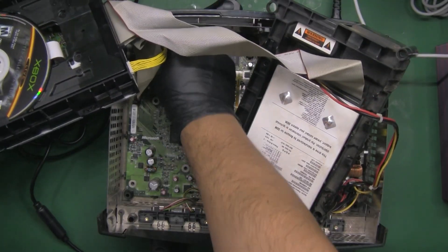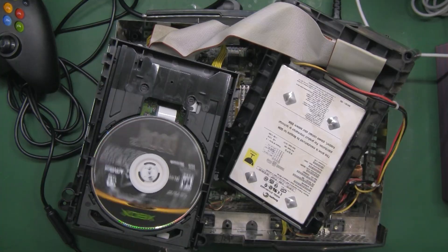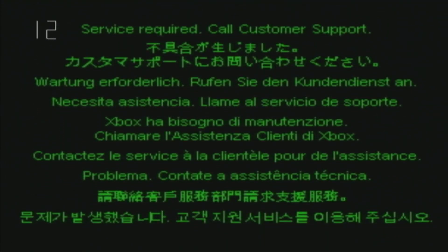If you've never encountered this error before, the internet recommends that you check your cables. I've put another drive into this console that I know works, so I think it's safe to say it's this drive that has some kind of problem, but we will humor you and reseat our cables. The cables have been reseated — once again it's still trying, having some difficulties, and now we have error 12. The fact that we're getting two different errors warrants further investigation.